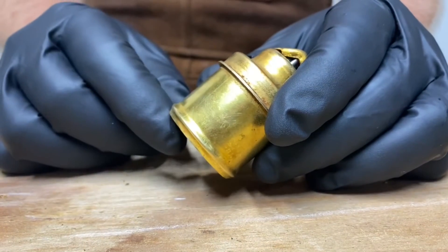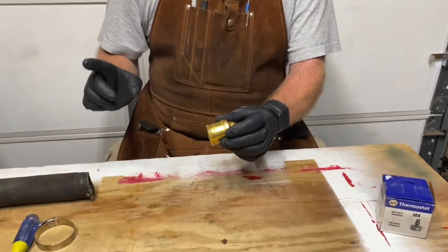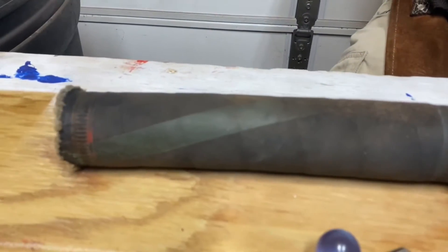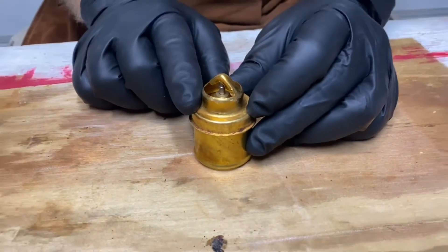One of the people in our Facebook group online, Bruce Haynes, has 75 tips and tricks for N series tractors, and that's where I got some of this information for the video — I want to thank Bruce for his information. He found out through his research that this is an in-hose thermostat, and that a thermostat for a 1977 Renault R12 1.6 liter engine also uses an in-hose thermostat and they're about the same diameter as the N series tractor. And you can get higher temperature thermostats for that vehicle.